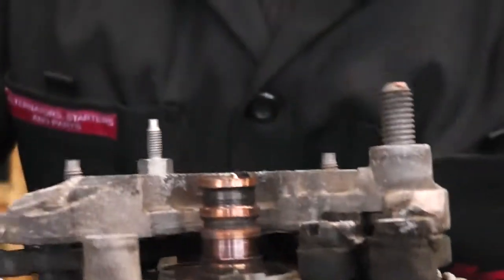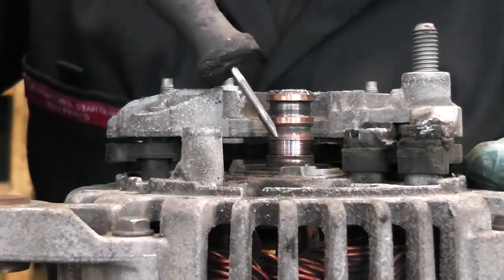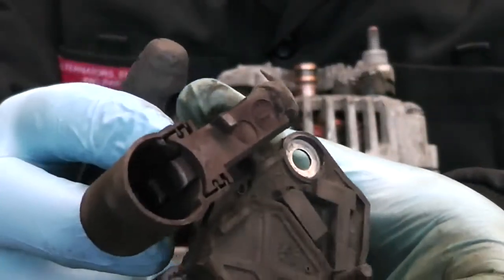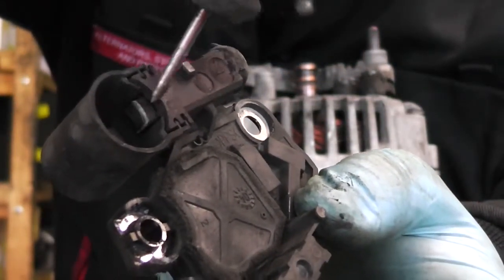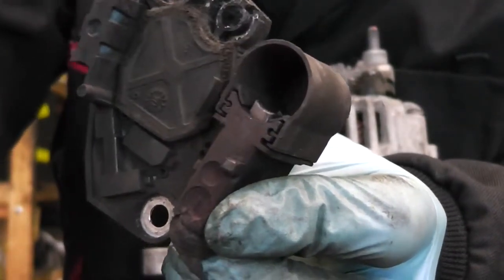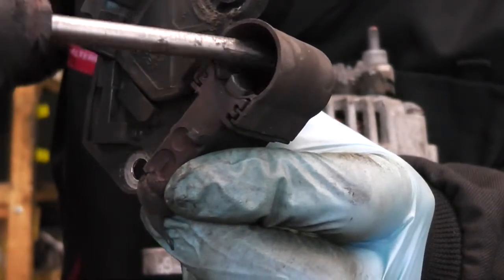To be 100% sure it's the problem, the best thing to do is to have a look at the slip rings. As you can see, the top slip ring is blackened and the bottom one is shiny. That means there was no connection being made at the top slip ring — the top brush is gone. In newer alternators in your regulators, the brushes are held back by a little plastic piece inside the cap. The best thing to do to take that inner cap out is to simply get a small screwdriver, shove it underneath the brush inside there, and just break off the little plastic piece — then the cap will come off.